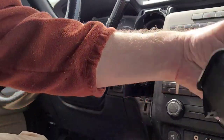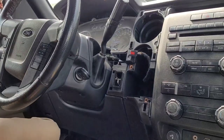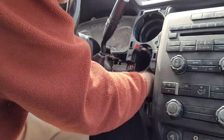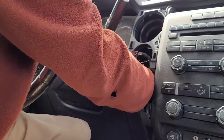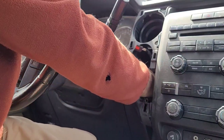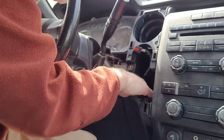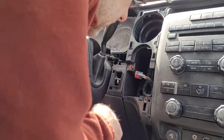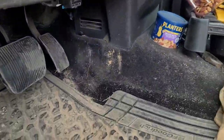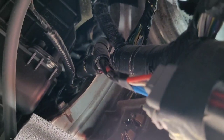I would have thought it would have been plugged in the back of this. I don't see it — has somebody else already been using it for a different one? Let me pause and get under here and see if it's hanging down there somewhere. Okay, I want to show you guys where it's at. It's taped up right here. So we're going to get this tape off and feed it up through there and plug it into the back of the trailer brake controller.